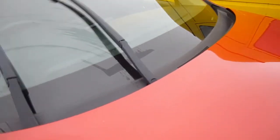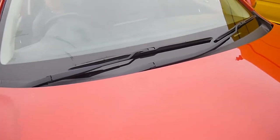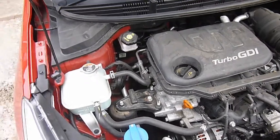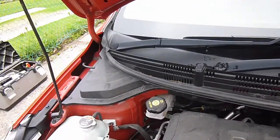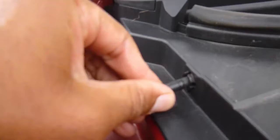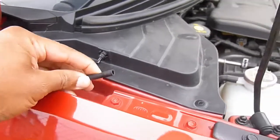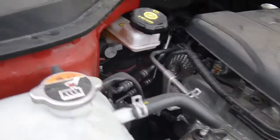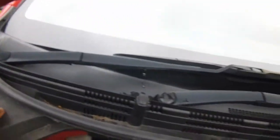We've already had a little exploratory look and the pump and everything seems to be working quite nicely, so I think we're going to have to dig in a little deeper. We'll pop the bonnet up and have a quick look. I've managed to locate the pipe that feeds the washers — if we pop this off, you can see we've got loads of pressure out of there. So from that point to the washer tank there's definitely not an issue, meaning the problem is further along. We're probably going to have to take all this plastic covering off and possibly the washer arms as well, so wish me luck.